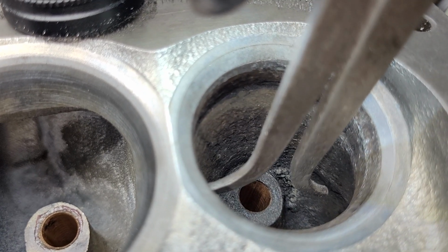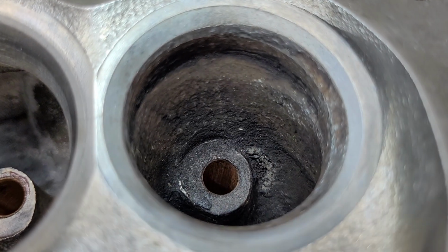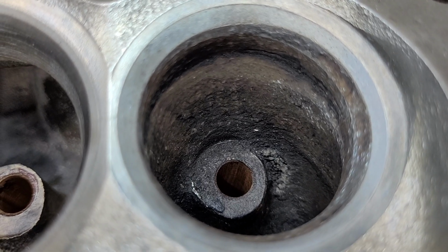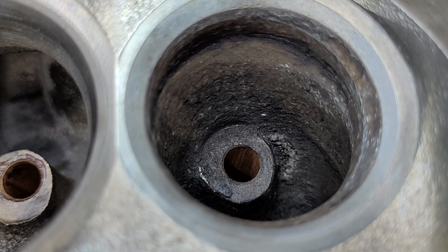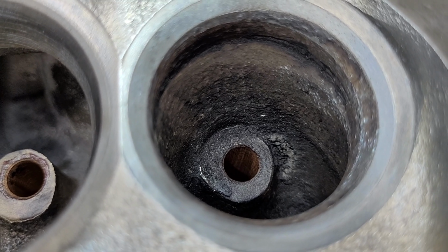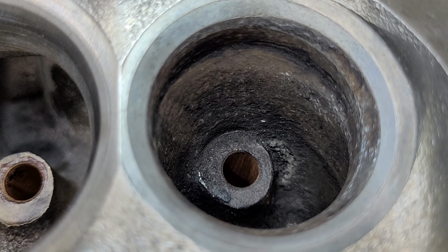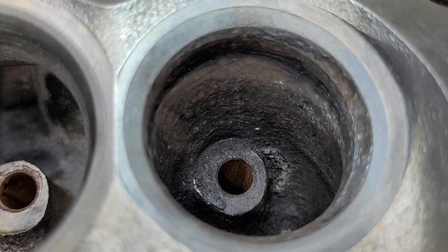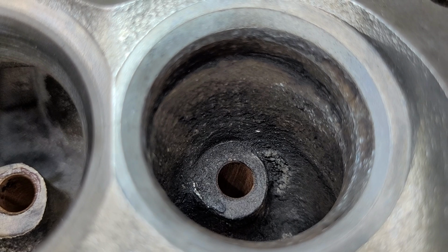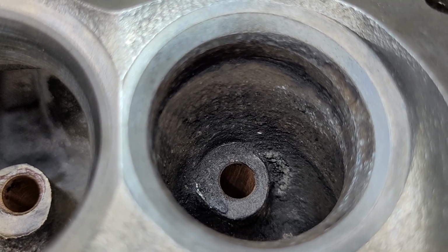And as far as bowl width, that's the difference in the bowl width. The LA's got a much tighter bowl. These are important things. Much tighter bowl than the Magnum. All right, so you had to give it some area somewhere. You took up a lot of area with that, filling in that short side radius. You got to make it wider to get the gases out. This is so much of a better design. It's not even funny. Huge difference. Huge amount of torque and horsepower gained with this improved exhaust port.